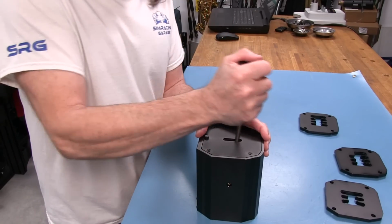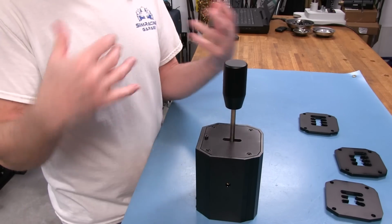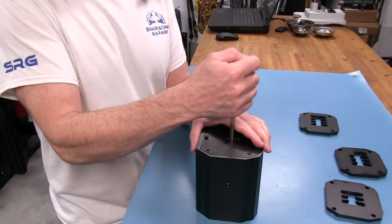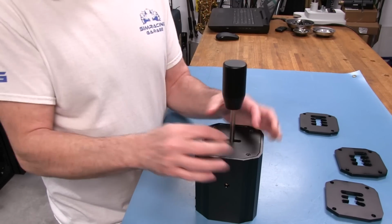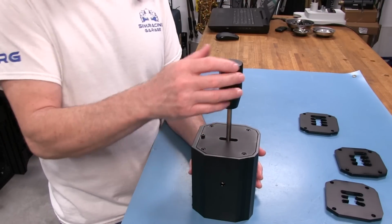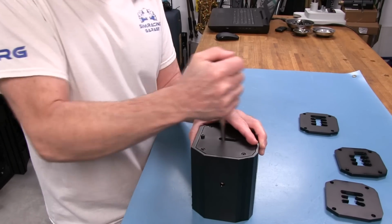There's no notch to this when you're pushing it. It's not like you're pushing through a notch and making a mechanical change. But a lot of sequential shifters in modern cars anyway don't have that, because there are just sensors in there. And the sensors are sending the signals to the gearbox, and the gearbox has an electric motor turning the indexer shaft sitting on top of that sequential.